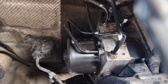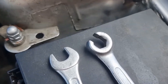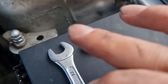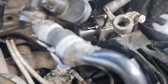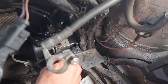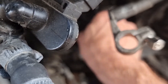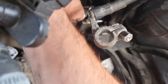I'm going to get an 11 mil spanner now they're cracked open. When you're doing this job - same with any brake lines - you want one of these brake line spanners rather than a normal 11 mil, because the shape of it stops the bolt from getting chewed up. So now I've cracked them off with that, I can use this 11 mil. They are all loose.